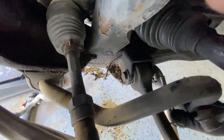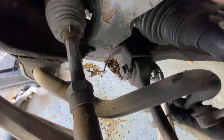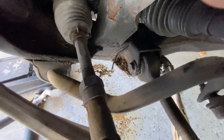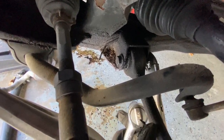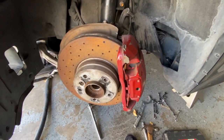remove this bolt. So I got my channel lock right here. And I'm gonna use this 19 on here. I'll loosen this arm and drop it down. And I should have enough room to pull it this way and get it out.